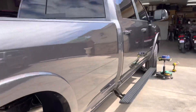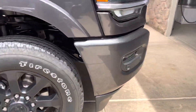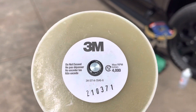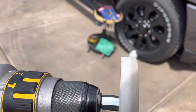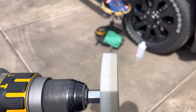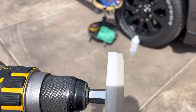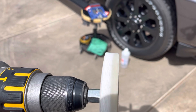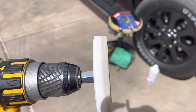So I ended up using the 3M destriping wheel. I didn't take a chance and get one of the cheap — we'll just say Chinese ones — this is the 3M one. Basically the instructions said you're best off to put it in a drill and use a cheese grater style file to get it concentric, because when it comes out of the bag it's kind of oblong and not circular. So I have a lathe — I just put it in the lathe and took a cut on it to make it circular.